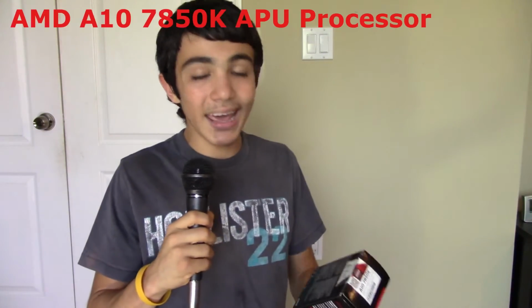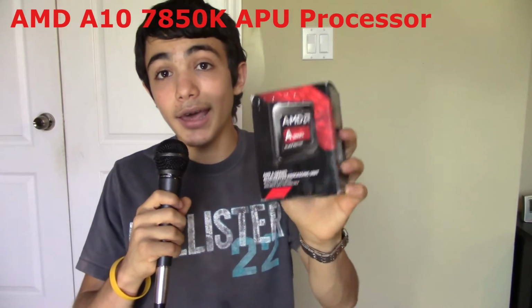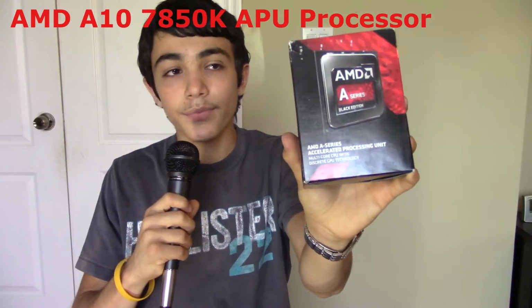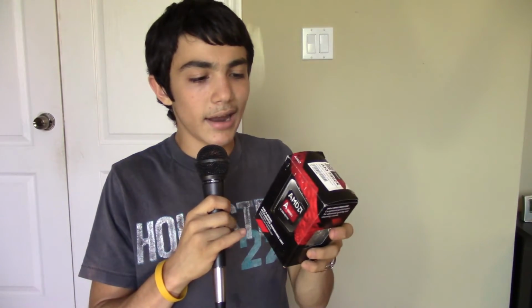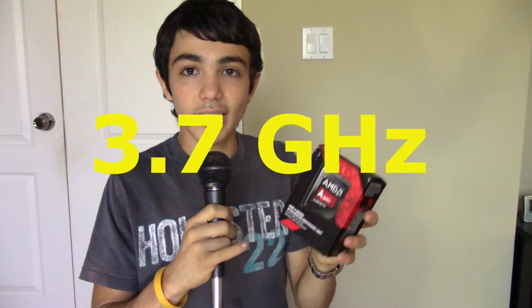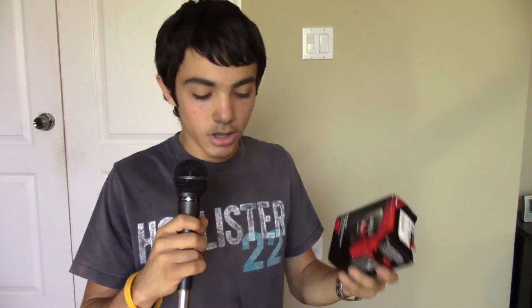Now for the processor and graphics card, we're going to be using an AMD APU A10 7850K processor. Now let me explain what that means. First of all, this is an AMD A10 quad-core processor, clocked at I believe 3.6 gigahertz out of the box. But with the Gigabyte motherboard that we have, you can go into the BIOS and overclock it. Very easy. If you guys want to know how to do that, just leave a comment below and I'll make a separate video. But I actually have it clocked at 4.0 gigahertz.